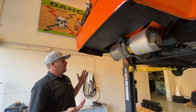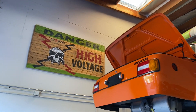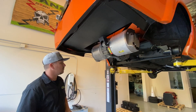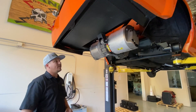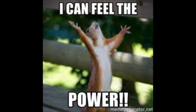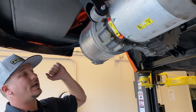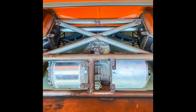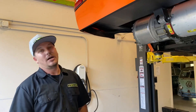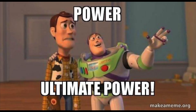This is the power plant for this 2002. Like we said earlier, we were going to run the small Tesla drive unit, but after talking to the customer he wanted to run the large drive unit. So we had to come in, cut off the old mounts, and remount the large drive unit so it would fit. This drive unit will have about 400 kilowatts. If we decide to go with the P model, we'll have about 450 kilowatts, which is going to be in the range of 580 to 600 horsepower. Above the motor, to reinforce the chassis since it is a unibody, we had Action Vehicle Engineering do the cage structure, which strengthens the rear end of the car to support this motor. In comparison, the stock 2002 has about 100 horsepower, and the motor we're putting in is going to be between 580 to 600 horsepower — so we're upping that a little bit.